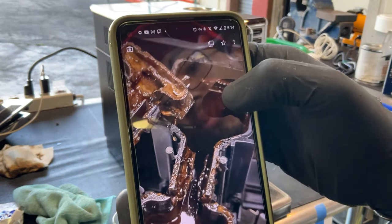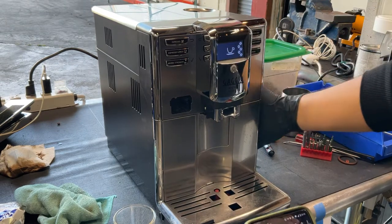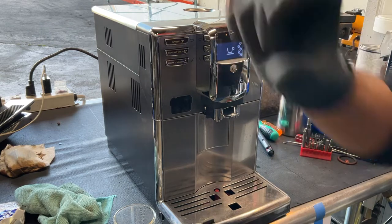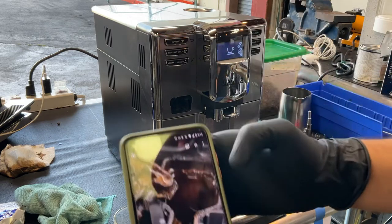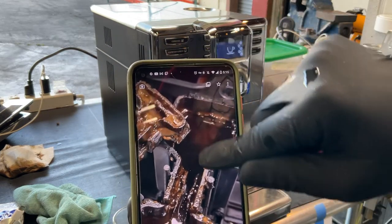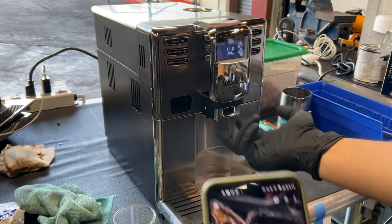Just to explain what we're watching here: whenever you do coffee on your machine, the machine will grind the beans, which will get into the brew unit. The brew unit will push those ground beans into a nice little puck, and that puck will get water from the water pump and thermoblock all the way into the spouts. This is the spout — this is where exactly the water comes in. It comes into this chamber completely and then it goes down into the spouts, which will be right here.